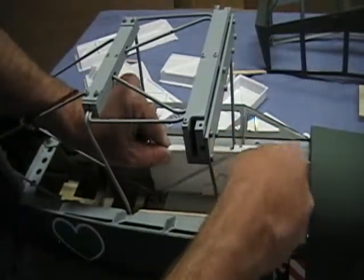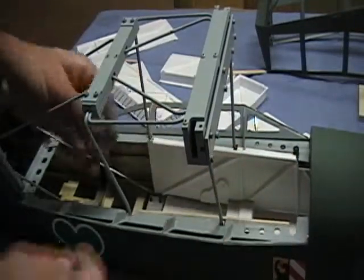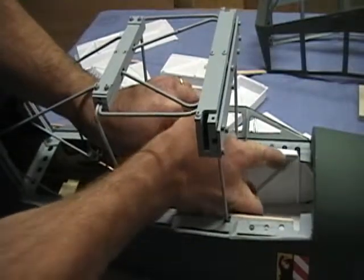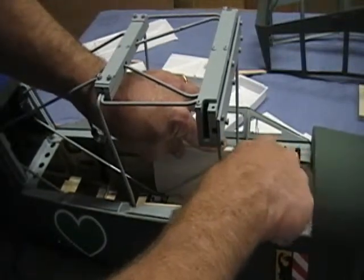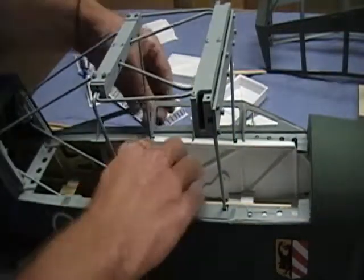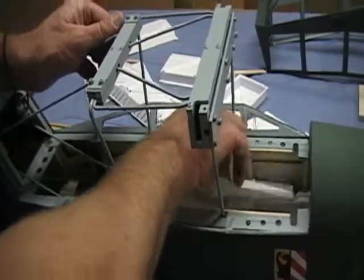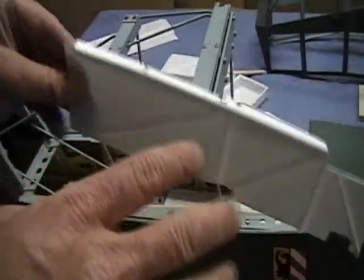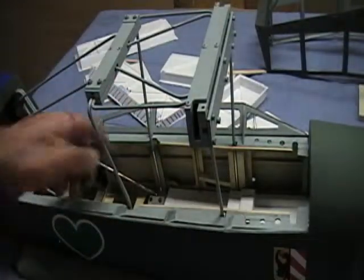You can take your piece, lay it in here, and see where you need to make those notches — just slide it down and mark them. I'm going to suggest that you come in here, cut this pretty close, and slide it into place. You'll see it slides right over; glue it down using a short flange and then re-sheet this whole area with some ABS that I include with the kit — it'll make it stick a little bit better. Once you get the sides cut out, you can start trial fitting until you get it cut the way you need it.